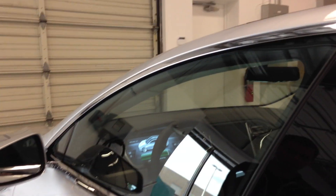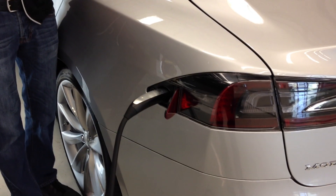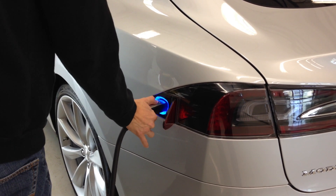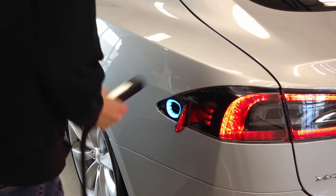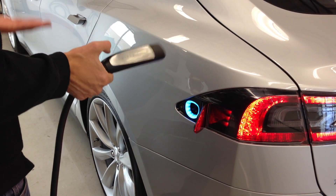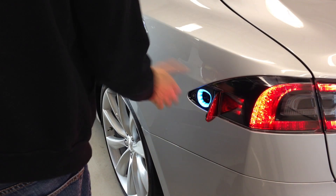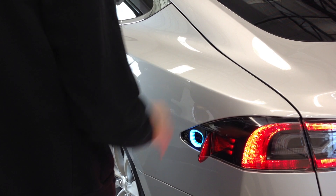If you go ahead and lock it by pressing the top of the key once, the screen goes off and the charge port light goes black — so if it's sitting outside at night, you don't have flashing lights affecting people. If you try to pull the cord out, it's now locked in there and can't be removed. Press the top of the key twice to unlock it. That same pin that locks it in place will also pop up automatically after about two minutes if you leave the port open and walk away, so if you come back and find it's not going in, close the door and open it back up.